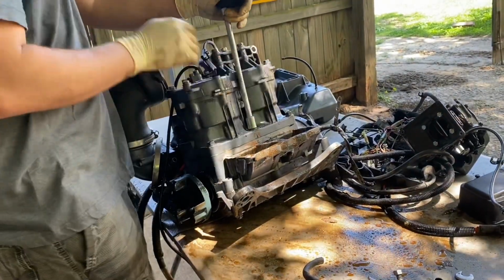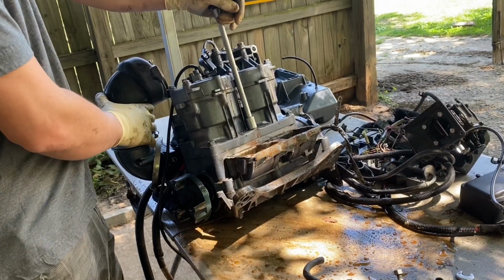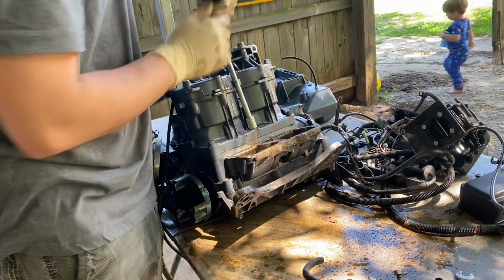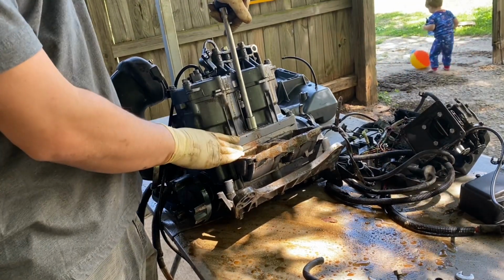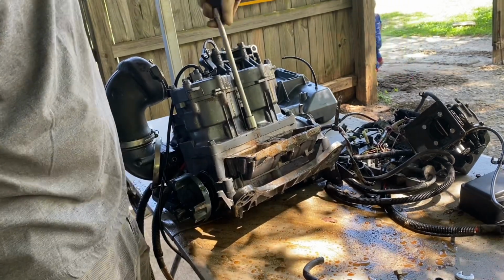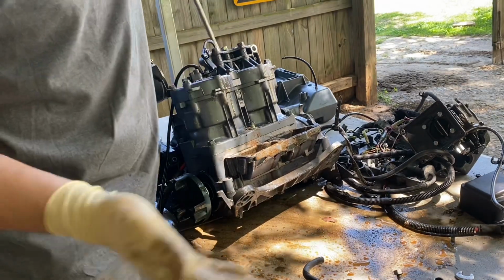I pulled the 6 bolts for the cylinders off and just bring the head pipe and all with it. Just a quick and dirty way to remove it, because all I'm doing is repairing the base gasket and cleaning all this nasty oil and watery mix out of here. All I want to do is go jump logs.